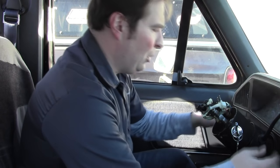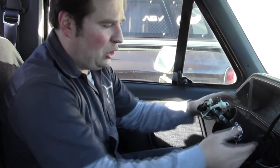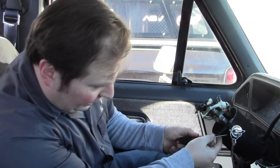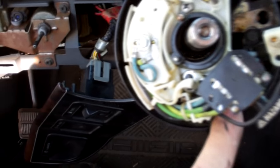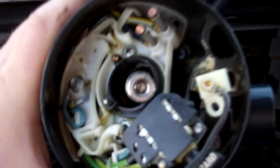We've got things torn down a little bit more. I took a little bit of the trim off because I want to show you inside — you don't normally have to do this, but it's just for better visibility. The next thing we've got to do is take the lock cylinder out. To do that, you press on this button, but you have to have the key put into the run position, press it in, and then it pulls right on out. Now with the three screws out — one was right here, one here, and one over here — you can pull this housing out and we'll expose what we're trying to fix.